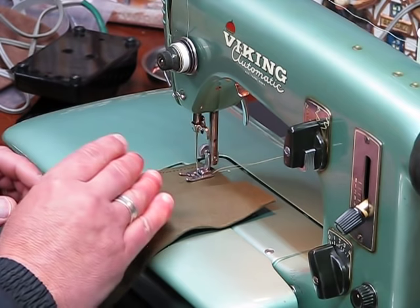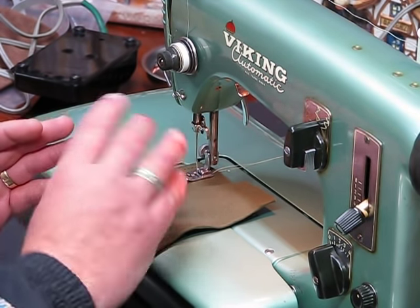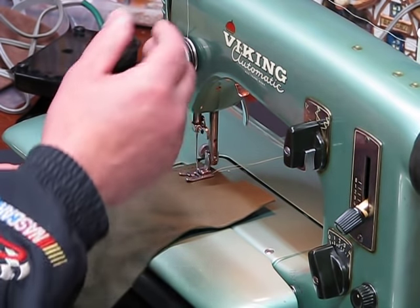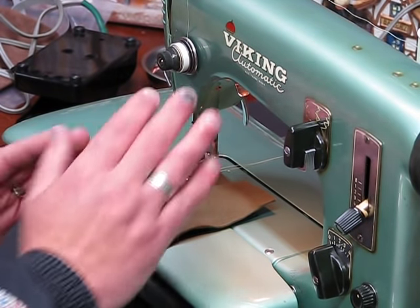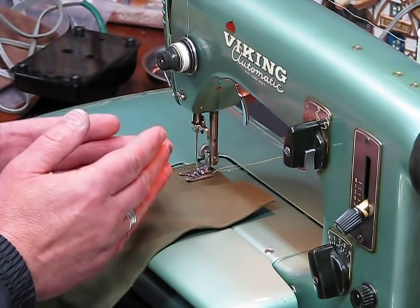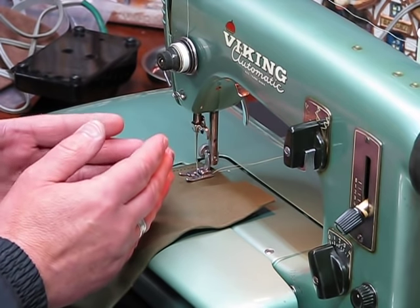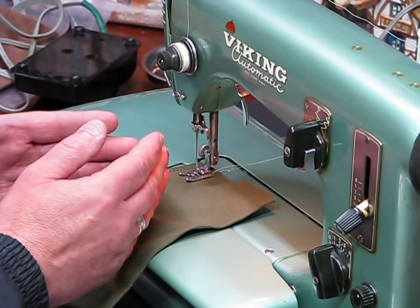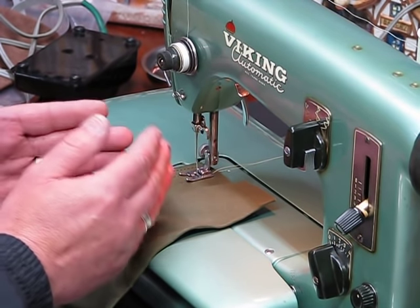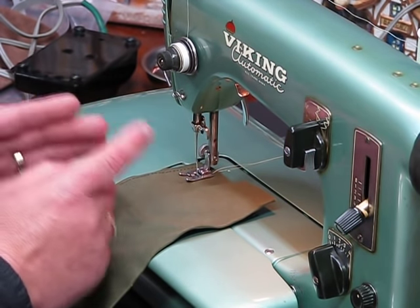That's why you saw me in that video that I posted on Facebook and on YouTube hand cranking after the timing was adjusted on Erin's machine, hand cranking so that I could very gently and very carefully check the parameter and the swing of each of the stitches that this machine can do. Because if you just make an adjustment on a machine, whether you're skilled or unskilled, and you throttle that foot control, you're going to potentially damage that machine if you got it wrong.